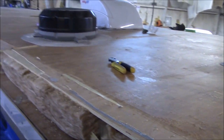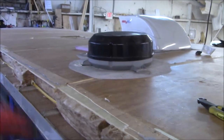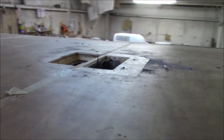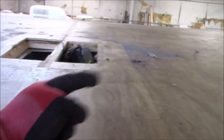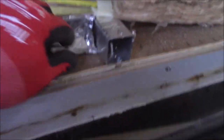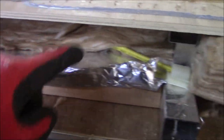They're just not something that I would endorse because there's too much wrong inside these coaches when you open them up — and that's why they'll fail. What's the sense of putting a coating on this? You may not have any leaks right now, but the whole thing is going to start sagging with the air conditioner on them. You can actually see a slight sag in this one. We haven't taken all the decking off yet, so we're going to see what's going on. See how they've got that truss right in the center and just got it blocked over with bridge blocking going across? You should have something a lot more substantial than that. Now you're going to have cold air come out here, condensation will build up because you've got a hot roof.